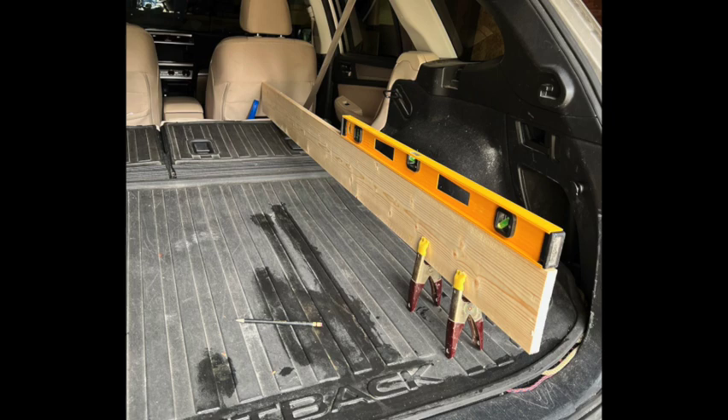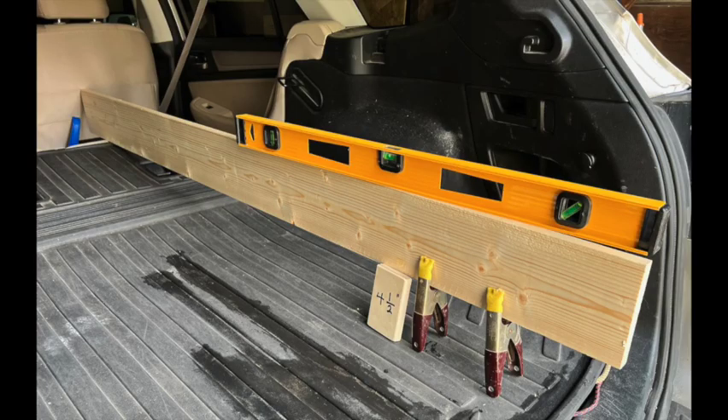I start by putting a 1x6 along the length of the bed and raising it up on clips to get it level. This is also the same car already on a level surface. In my case, I can see there is a 4 and a half inch difference between the front and the rear of the board, so I made a little piece of wood that dimension and put a pin on the top edge and slid it along the floor of the van to draw a line on the 1x6 to get the proper slope so it will fit and make a level platform inside the SUV.